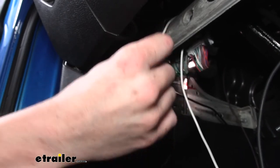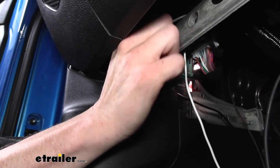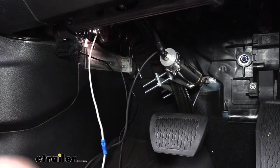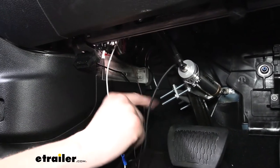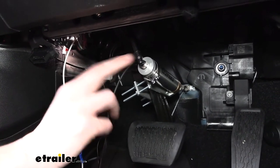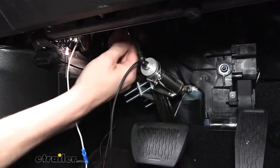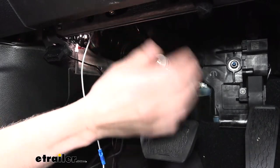Slide the ring terminal through and reinstall the bolt. Now with all wires hooked up down here, we'll be using cable ties to secure everything. The airline hose routed through here simply goes over towards the cylinder — trim it to length using the special hose cutters, then poke it into the quick-connect fitting. Make sure to leave yourself enough excess for pedal movement so the hose can move freely and won't get caught on anything.